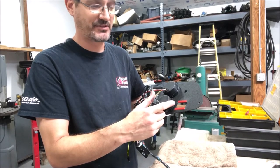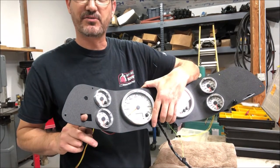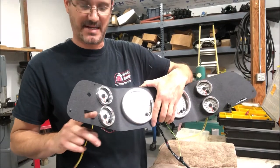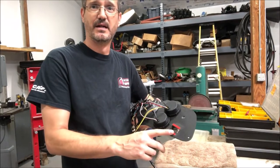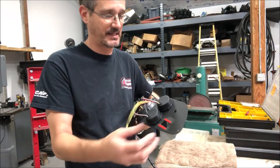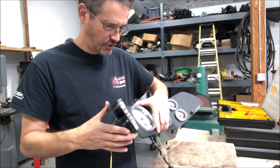You'll actually need to cut one of the metal tabs off of your existing headlight switch or wiper switch and it's going to go right in here. The switch pokes through and you just need to make sure it has full travel. This opening is the same size as the factory one, so you just need to center it in here - it fits really good. This stuff holds like nobody's business. There are times we've had to take them apart and actually broke the switch taking it apart. Your headlight switch goes in just like your factory one - it goes through the back, you have that on the front, and you're good to go.